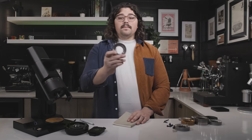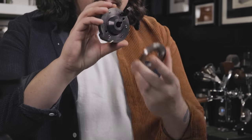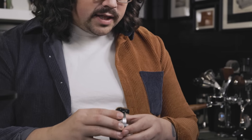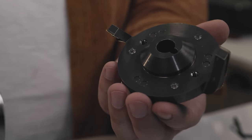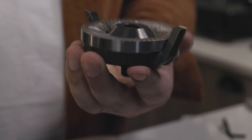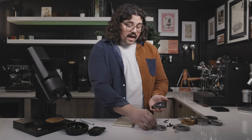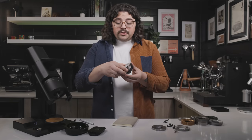What's really neat is the burr carrier is actually magnetic. The standard burrs that come with the EG1 are blind burrs — what holds them in place is an incredibly strong magnet. There are three sets of two magnets on it, and when you put it on it sticks on really tightly. Before that, you put a few pins in to guide it into place, lining up the three holes on the bottom. You don't have to use blind burrs — as you saw I had the E80s on just a second ago. There are also two screw holes that fit typical screws for 80mm burrs made by Hemro. I also want to thank Hemro for sending over three burr sets of their own that I could test.